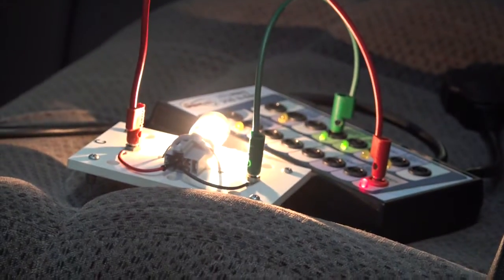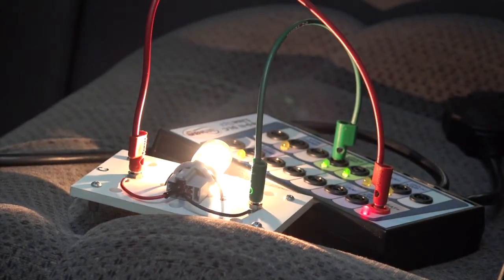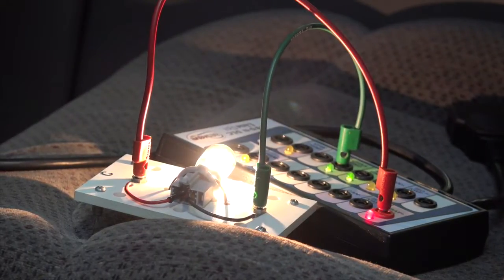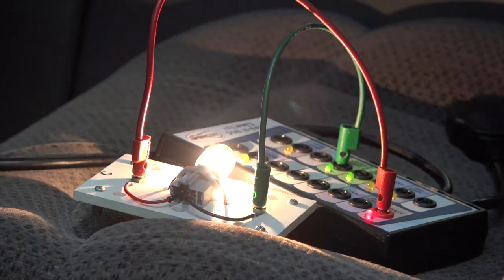All right, so what we have there is the data link connector, and I happen to have, again, a data link connector breakout box plugged into that, and again, I've got a light bulb being powered by pin 16 and grounded at pin number 4 of that data link connector. So that is the problem in this case, and again, I installed that for the purpose of the video.